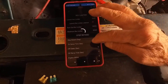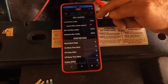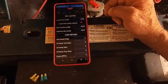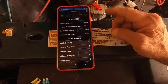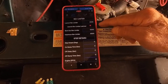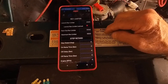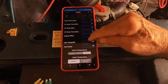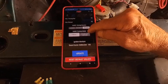I have the light blue wire going to my brake pedal, so it's got a two-step now. This will also work with my line-lock button. I might lower that launch RPM, but anyway, the 2D Plot and Normal setting is reading the timing chart.